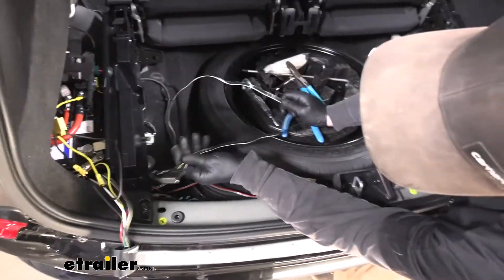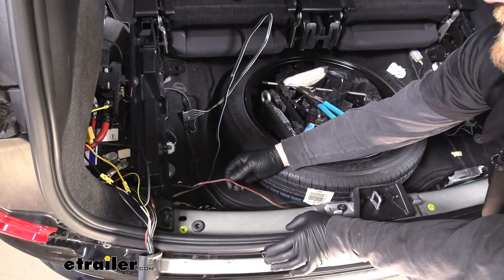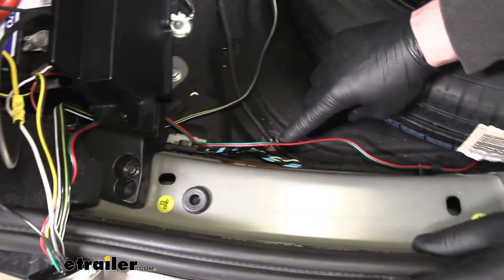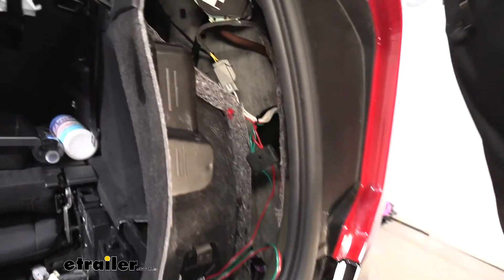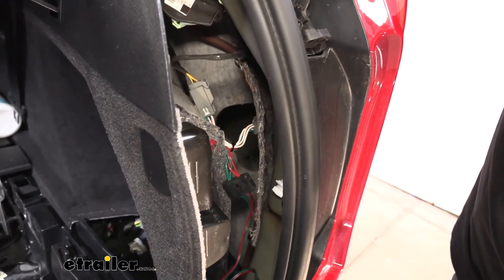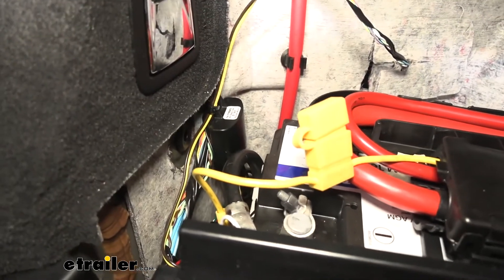The four-way flat connector gets pushed underneath this piece of plastic into the spare tire area and we'll just let that hang out for now. The other T-connector wiring — the green and red wire — is ran under there as well. Then we bring this over to the passenger side, loosely routing it through the opening so it comes up behind the panel. We plug it into our electrical connectors just how we did the other side. We went ahead and secured the wiring and the module box, tucking it down out of the way and using a few included zip ties to get that done.